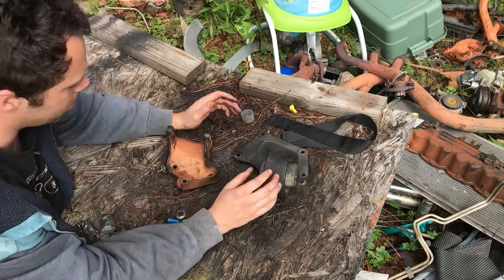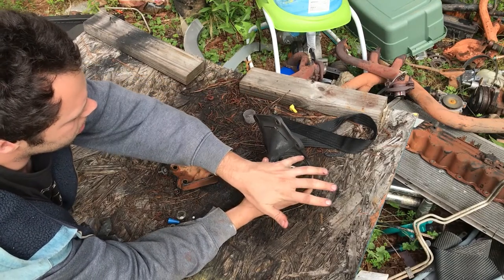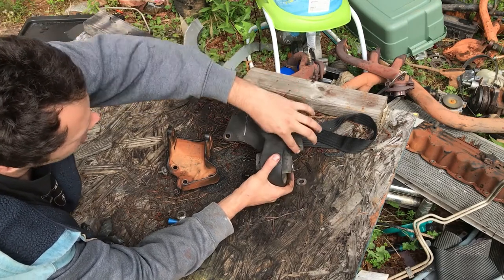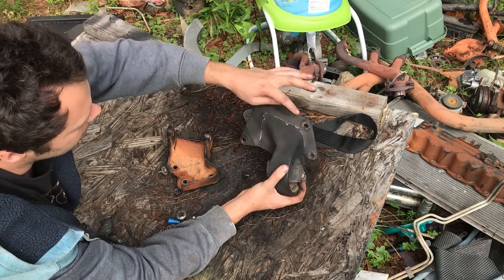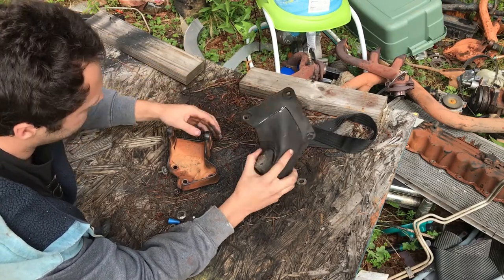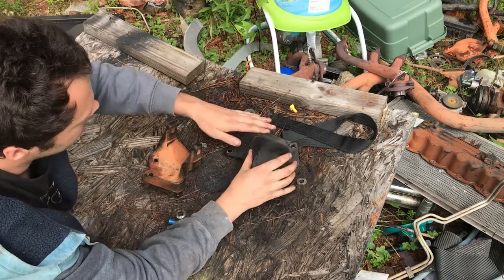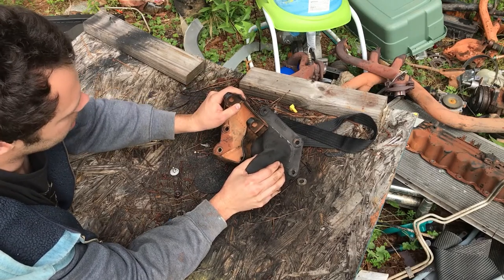So what I'm gonna do is, I've already started cutting. I need these bolt holes, this pattern here. So there's 4 bolts. I'm simply gonna cut out around here and just leave this pattern. I'm gonna weld a piece of steel here in the back, a plate. I'm gonna cut along here, and then I'm gonna weld this plate to this plate, and it'll be kind of like over in this area.